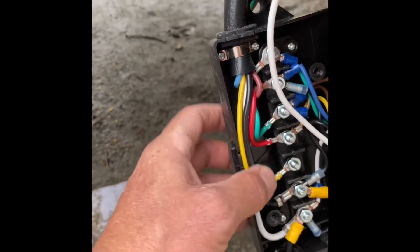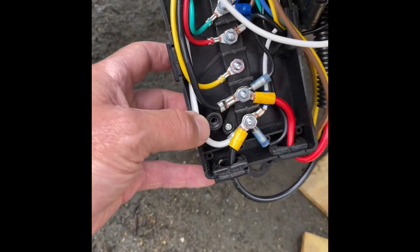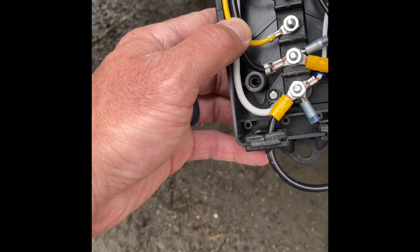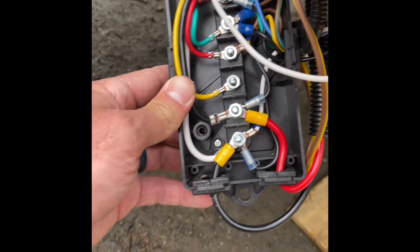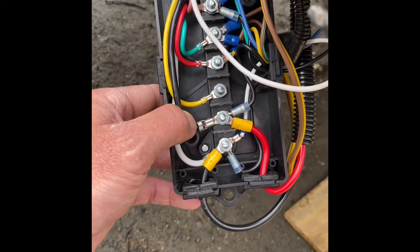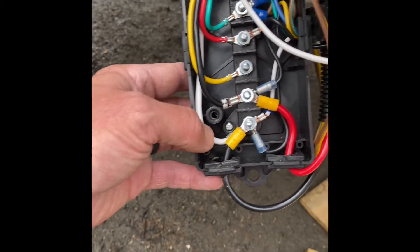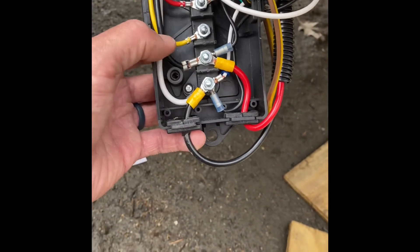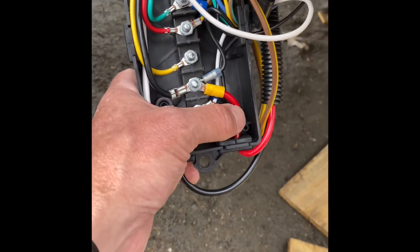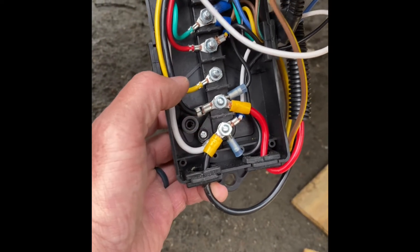You've got your wires here for your lights and brakes, etc. This black wire is a 12 volt power supply — it might be different in some other units, so you'll want to check yours. The white is the ground. Again, verify all this on your own, but for me that's the sequence we've got here. I ran a 10 gauge positive wire from the 12 volt power supply.